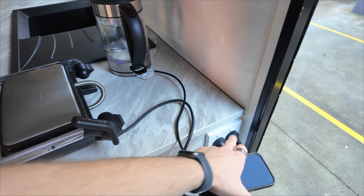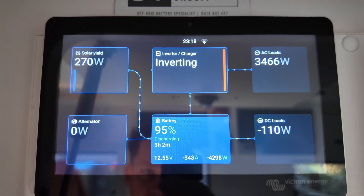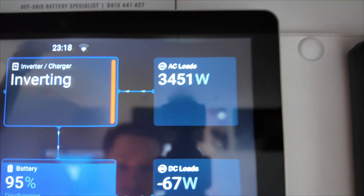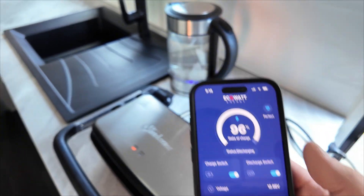Let's turn on the sandwich press as well. We're now pulling three and a half thousand watts and 345 amps. The wattage shown is what's actually coming off the battery — going from DC to AC through the inverter you get conversion losses, which is why the wattage number on the inverter and the battery are different. Off the batteries we're pulling 4,300 watts. The app shows one battery drawing 177 amps and the other drawing 179 amps — again, perfect balance for this system. Batteries are at 94% and solar is going to charge them back up.